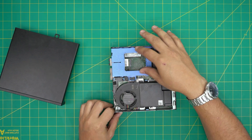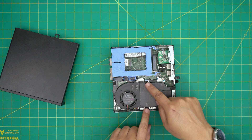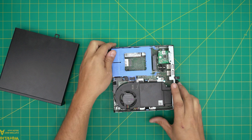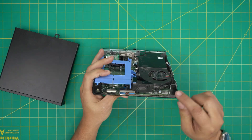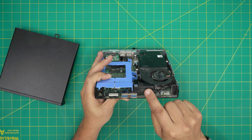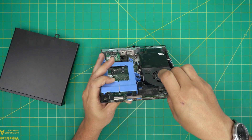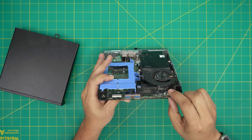You don't actually have to remove the carrier — just leave it there. If you have a hard drive, leave it there too. You want to remove the cover in here. Sometimes you need to loosen the speaker cable, so bring it upward and untangle it from the clip, making sure it's not tangled.